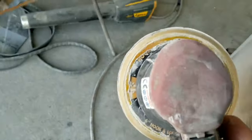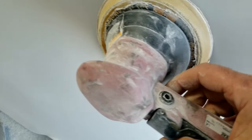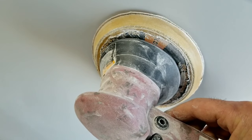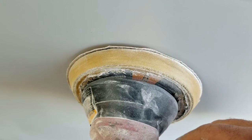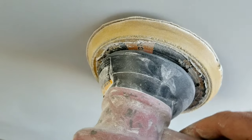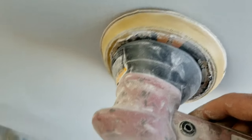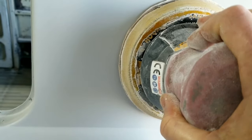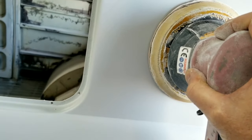The trick is to hold it flat. When you're holding it flat, you're kind of pushing just a little bit. Watch how much I'm moving it — I'm pushing it on the edge just a little bit, and you work that by pushing it up just barely on an edge like that. It's not like this — it's like this. You can just see that little tiny bit of movement, to where you can almost put your eye where it's focused on the top of the DA. You're not pushing hard. Don't push on the DA — hold it on the surface and let the DA do the work. If you're pushing on it, the metal moves, and you'll get waves in the work.